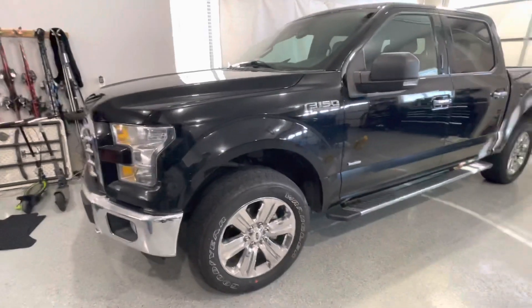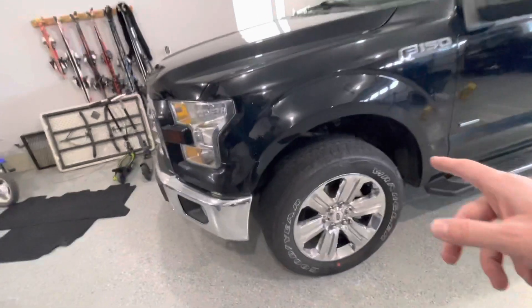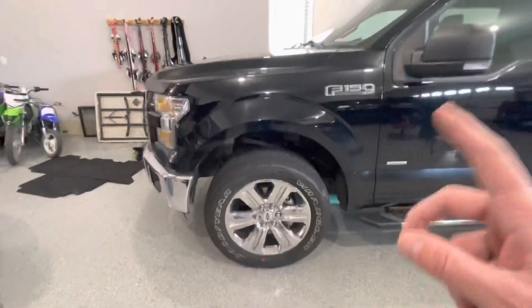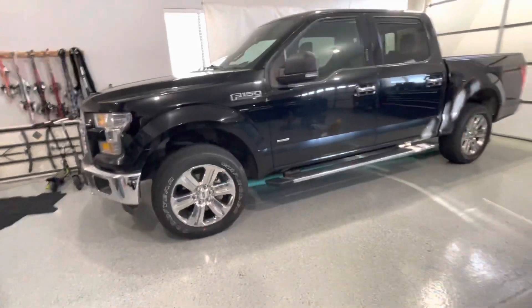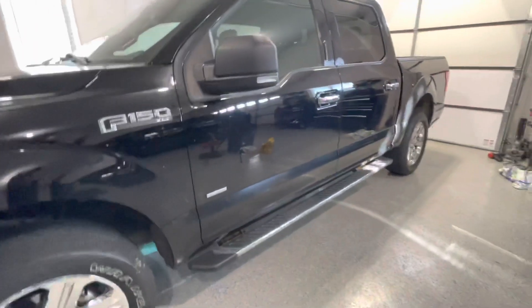One thing this thing probably needs is the front suspension. I didn't see anything in the service history about suspension work — shocks, struts, springs, anything like that. It doesn't handle that great. It does track down the line and drives pretty straight, but I would guess the shocks are still factory from brand new.